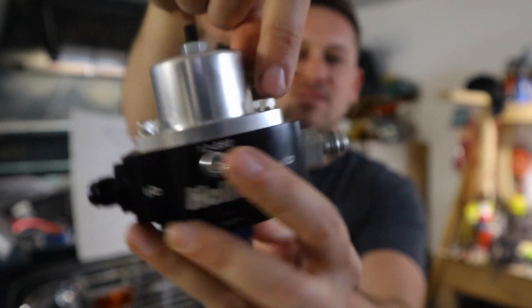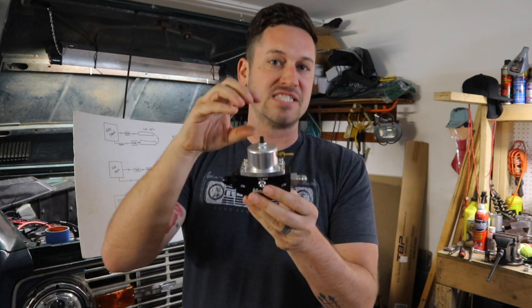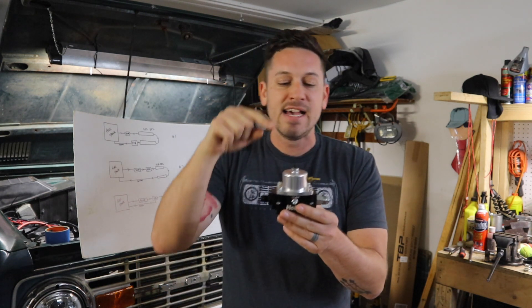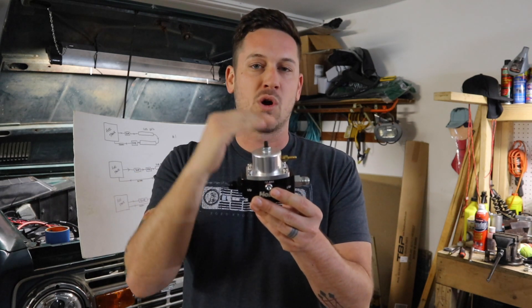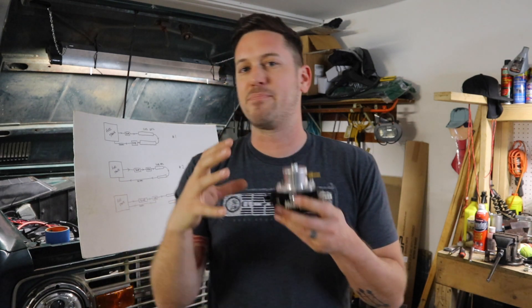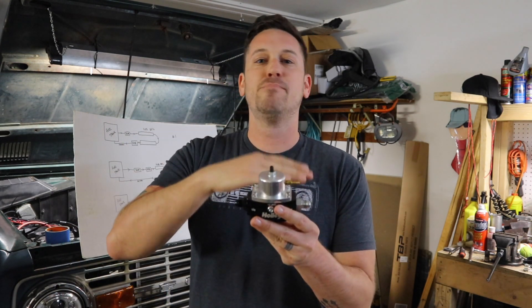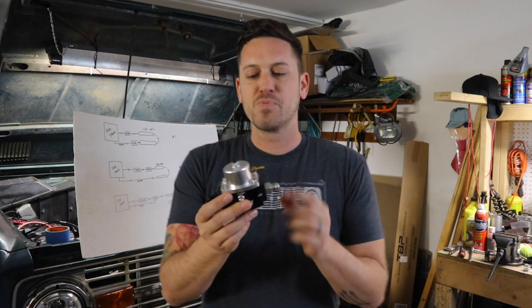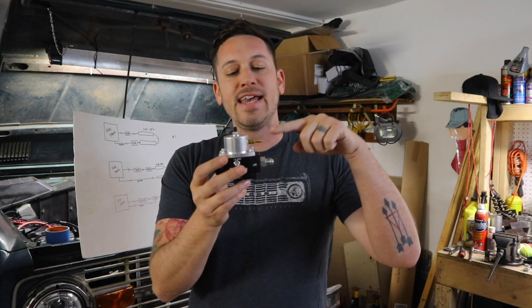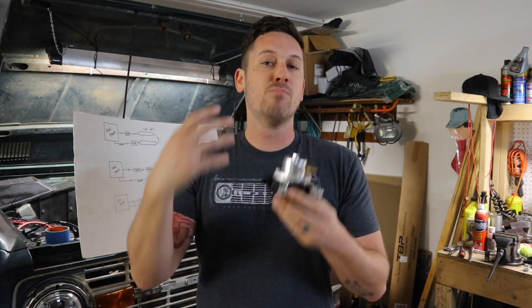The last thing I want to talk about is this little breather nipple at the top. This is super important. There's a spring inside for carburetor and one for EFI. The reason for that spring is when you open up the throttle and step on the gas, this allows more fuel to flow through. You might think, wait — I thought this was a regulator. What it's doing is reading the manifold pressure and saying, hey, there's an extra 20 PSI of manifold pressure, so we need to bump up our 43 PSI to 63 PSI to match. That number is way high for manifold pressure, but that's how this system works — it uses manifold pressure to regulate fuel pressure even more precisely.